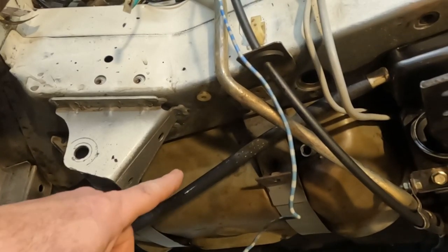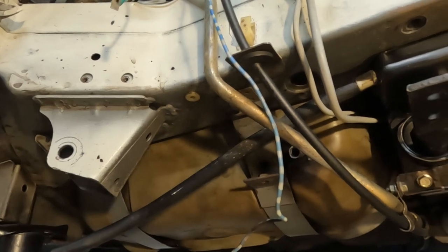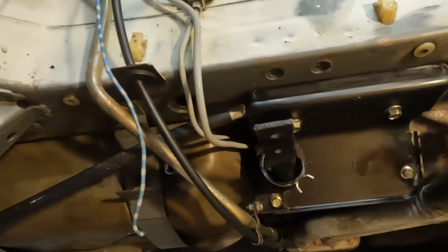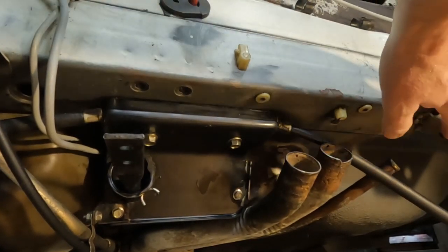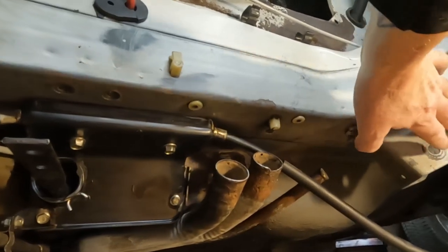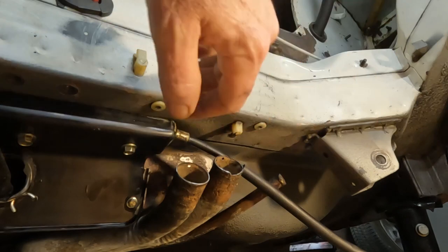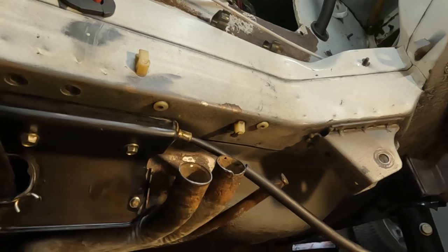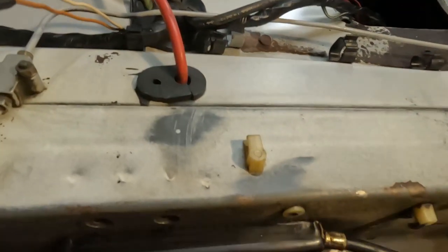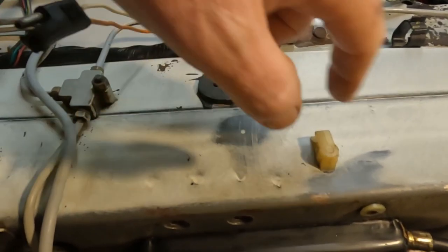And I don't know what color the gas tank is supposed to be, but this is the color it cleaned up to. So underneath, I cleaned everything back to here so I can paint it. Suspension connections have all been cleaned, and then all of this underneath. Degreased, Mr. Clean, and then wax and grease remover. Too much wax and grease remover on single stage paint pulls the paint off.